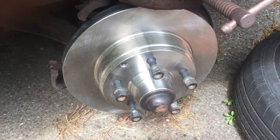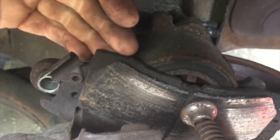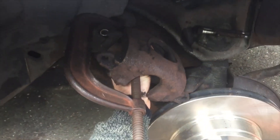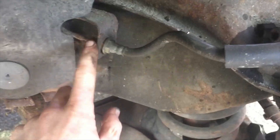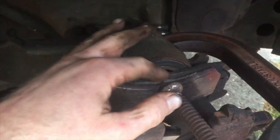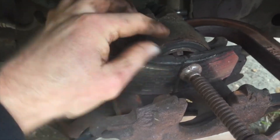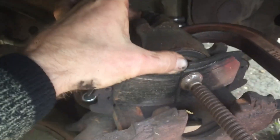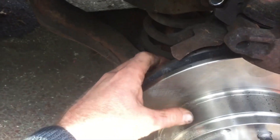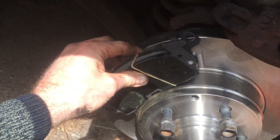In doing the Cadillac brakes, most calipers here have a cylinder that pushes the pad when you push on the brake. The fluid comes through the hose onto the caliper and pushes it. That hose goes to the master cylinder. When you push on the brake, you push pressure through this line into the caliper. The brakes squeeze together through this cylinder — this is a piston. The piston pushes out, the brake pads squeeze, and this brake pad will squeeze against the rotor to slow you down.